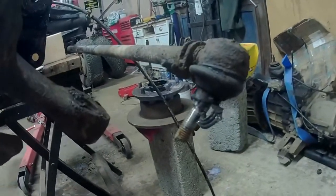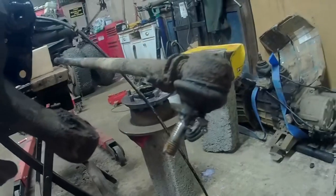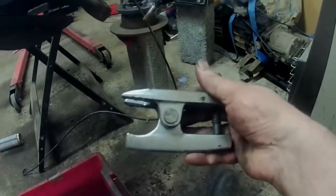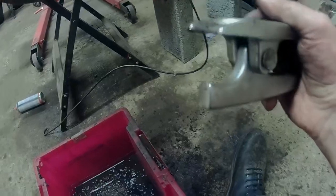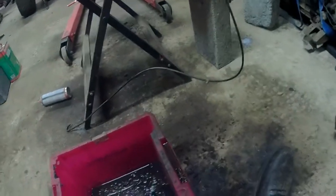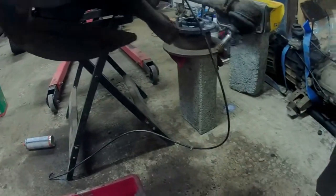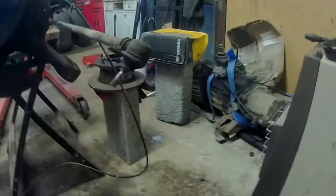Oh, I forgot to mention there were 19mm bolts and nuts underneath these. And I know you can clout them or whatever to release them, but it's not a good idea when it's sitting on top of a workmate. So I've been using my old trusty ball joint breaker there. I find these ones are actually very good. And they're also very good if you want to reuse the things, because they don't tend to wreck the rubber, unlike some of the other ones I've got. Especially the old pickle fork type one, as they call them. It just pushes right in there, and eventually it just knackers the rubber on its way through. But no, I found that one's definitely the best one for getting things apart. Very, very good. Right, back on to cleaning now.